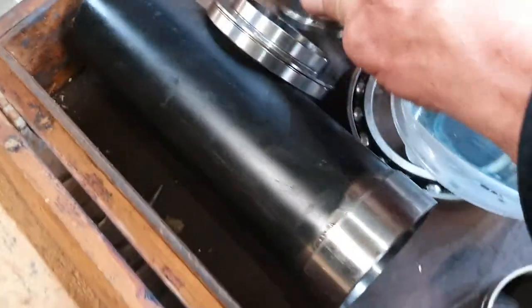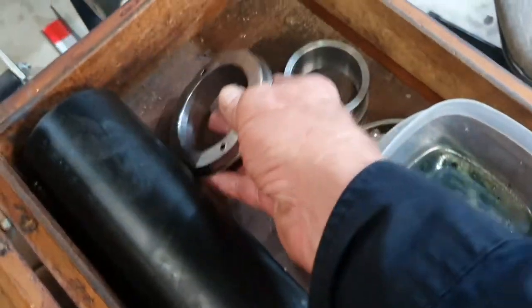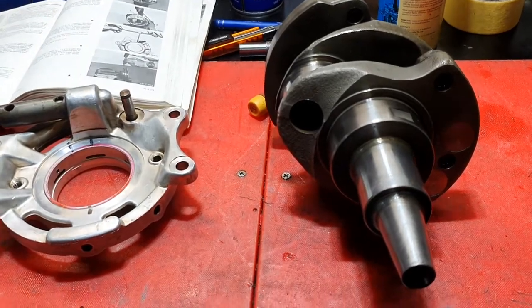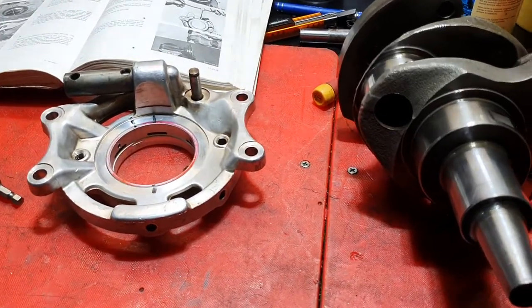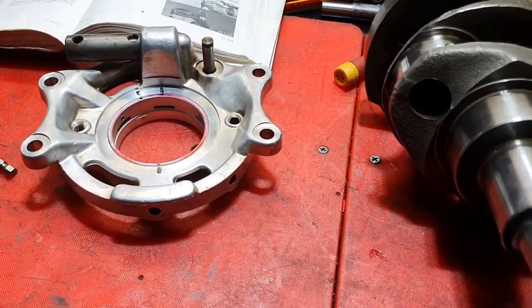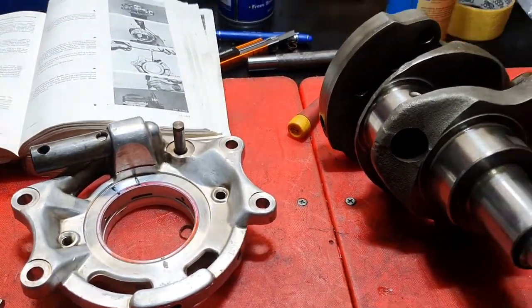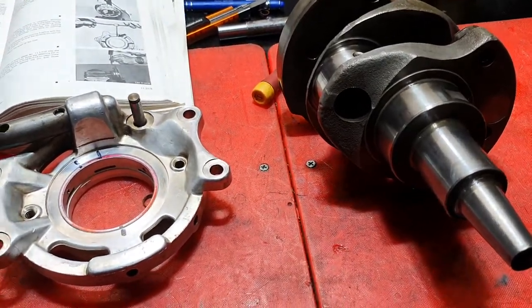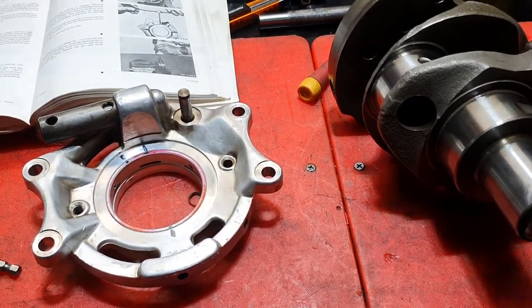This part here goes up and engages and holds the back of the block so it's got the strength to take the pressing of the bearing without distorting. I really do think that if you need to replace mains in your bikes, unless you're really competent with a well-equipped home workshop, you should just take it somewhere and get it done — but be aware to tell whoever does it about drilling those holes. So there you go, that's another afternoon in lockdown at the Boxer Works. Stay well, I hope you're all surviving the coronavirus and enjoying life. See you next time.